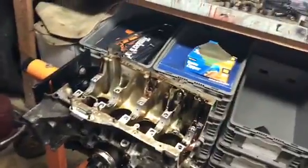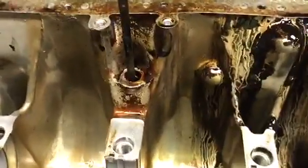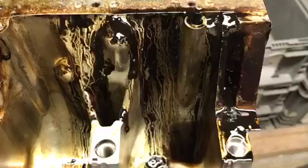Basically, I got everything pulled out. A little bit of wear on the bearings, a little bit on the seat, but the center bearing looks pretty good. They all look pretty worn though. I found all this sludge in the motor — I attribute that to it sitting for a year before I got it. Moisture and cold temp fluctuations will cause that to happen, so I don't think it's anything major, but we'll see what happens.